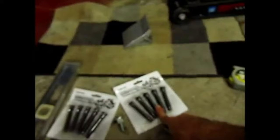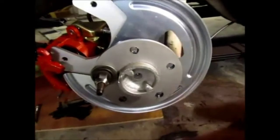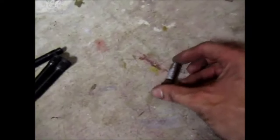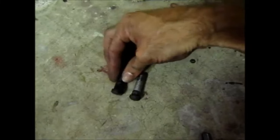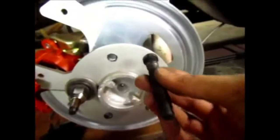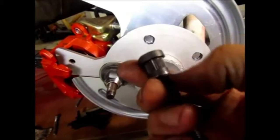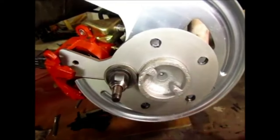What I have to do is knock the old studs out and press the new ones in. I just used this mallet and gave them a couple of whacks and they pop right out. The new studs have a wider edge than the originals, so I actually had to drill the holes out slightly — just a little bit less than the larger diameter — so the new stud can slide in. I didn't drill them out too much because I do want a tight press fit.